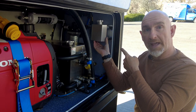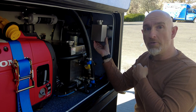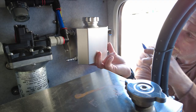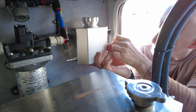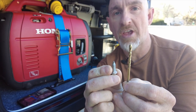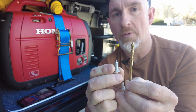This looks like the perfect spot for the catch can. It's close to the reservoir and it's a little bit uphill so the coolant will drain back down if it starts to get full. With my catch can where I want it I can mark where I want to drill the holes. I'm going to use a drill bit that's about the same width as the shank of the screw so that I don't damage anything when I put the screw in.